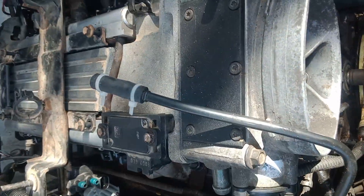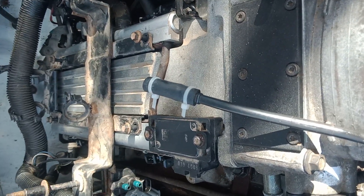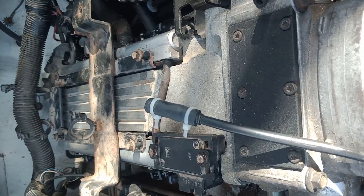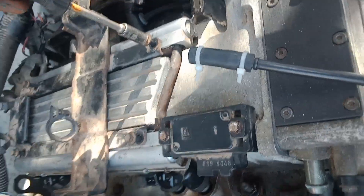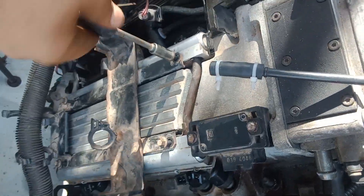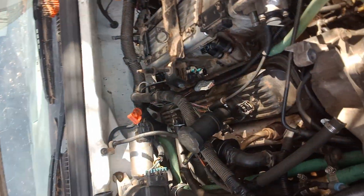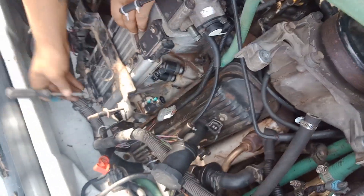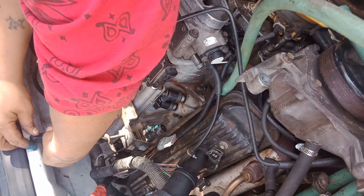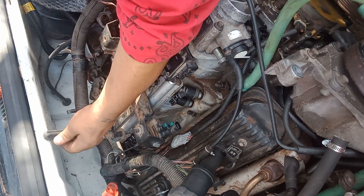What's up gang. Today I'm pretty much working on the fuel injectors. I got all the fuel injectors in the rows they need to be in, and right now I'm tightening them up. Hold this right here, and then do it cross pattern — not cross threading, but cross pattern. That's normally what I do.